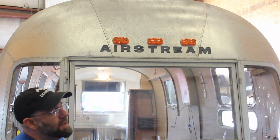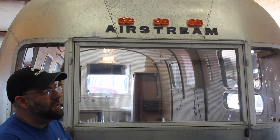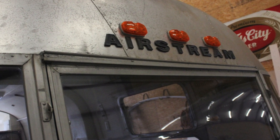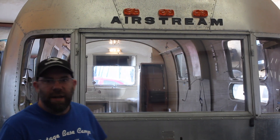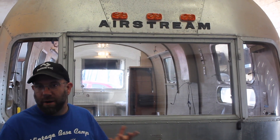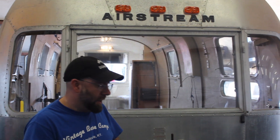The exterior LED lights are from Vintage Trailer Supply. Unlike lights from Amazon that come with positive/negative wires requiring extra grounding work and extra wires to stuff in, these have a single wire like the originals and ground off the actual frame of the trailer.